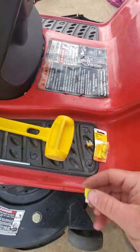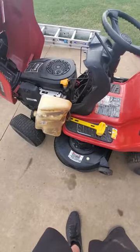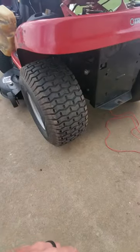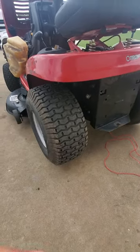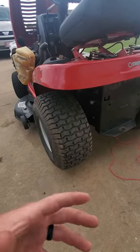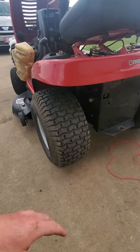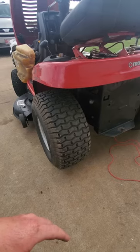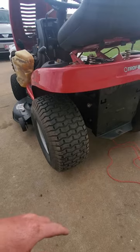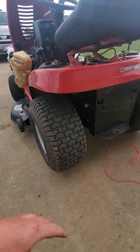This originally blew, and this is the one I blew during my testing. I watched a video — I was kind of confused this first time I went through this. The guy basically told you to go through, put a new fuse in, unhook something, and turn the key on — if it didn't blow, that's your issue. Well, I figured why not unhook everything and then slowly hook everything back together with the key on, and whatever I hooked up when I heard it blow would be the issue.